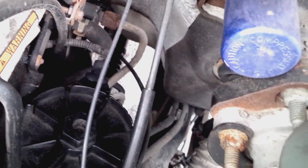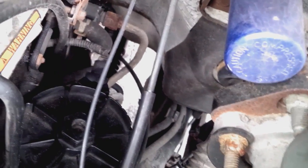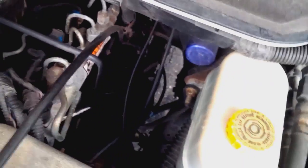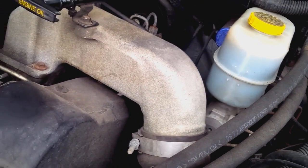They're known for sudden failure. That's why I carry a spare one with me in the truck. Now, your truck may have an advanced aftermarket fuel system on, such as a FASS or AirDog, and that's great as well, or it may have been converted to the in-tank pump, which generally lasts a really long time, oftentimes the life of the truck. Chrysler started putting those in 04.5, but it's possible to even find an 04.5 with this filter mounted pump.